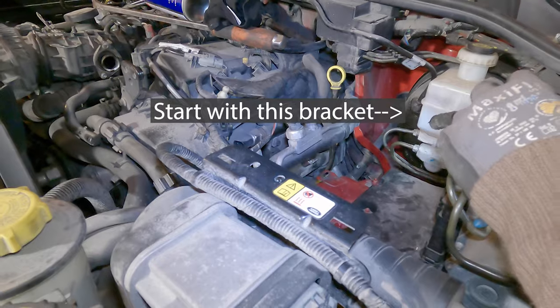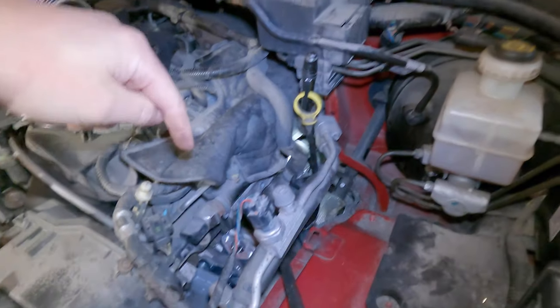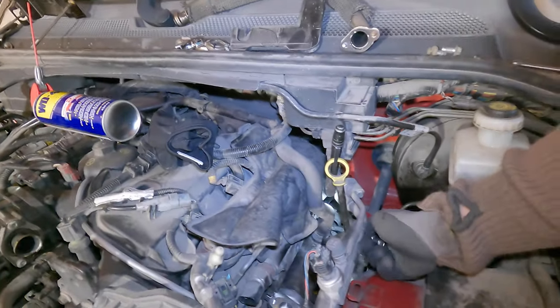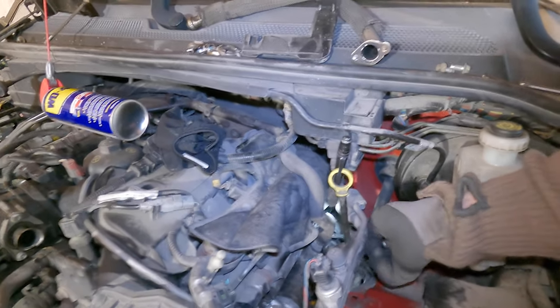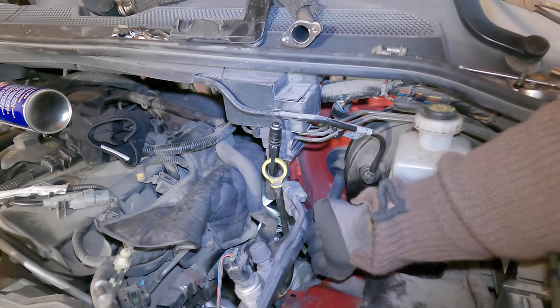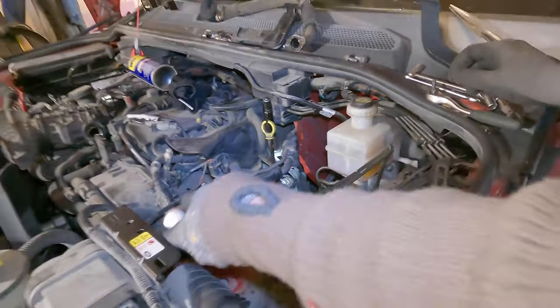We're just gonna assemble the rear bracket, dipstick, and tighten the three bolts and the connector. Okay, so now the EGR is in, connected to the cooler, we got the clamp on in the rear, and we put it on the bracket. So there's two bolts: one connects the bracket and the cooler into the block, and another one connects the hose. Okay, so we're gonna tighten the three bolts on the front. And we're gonna do the dipstick.